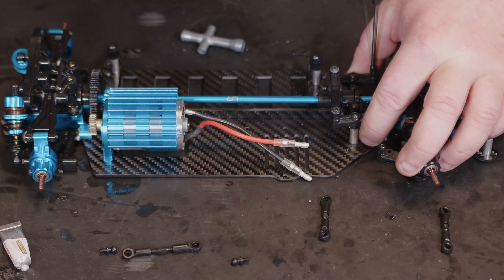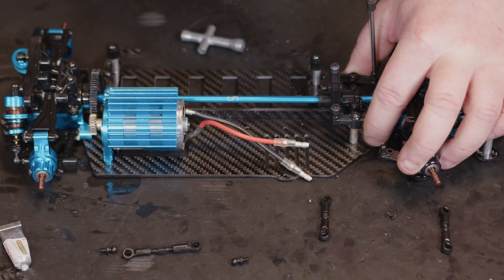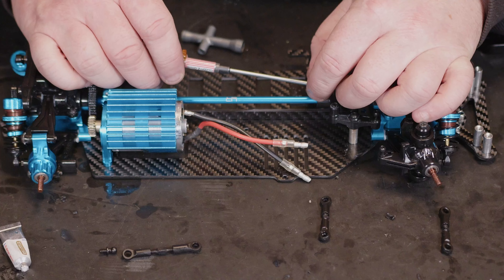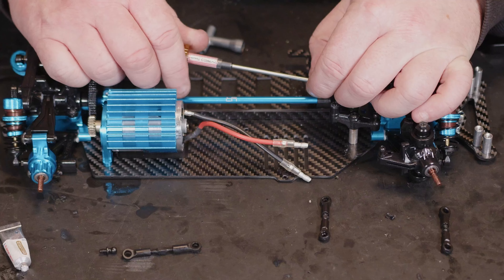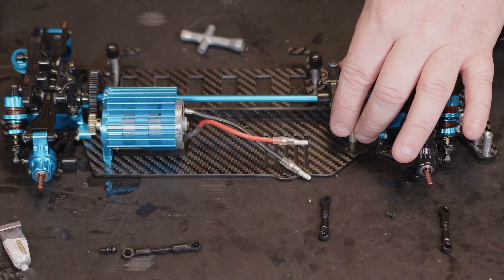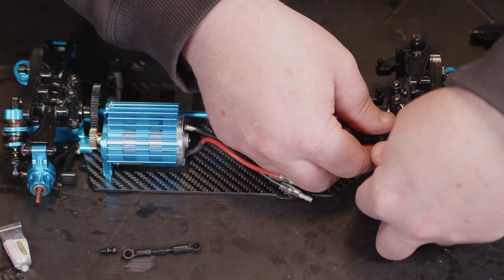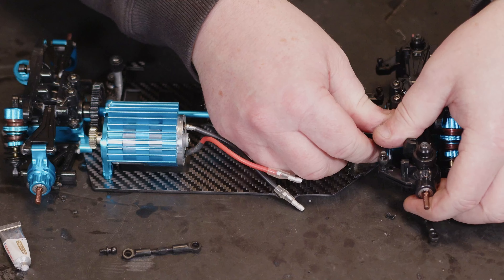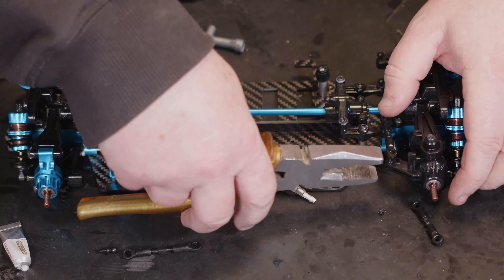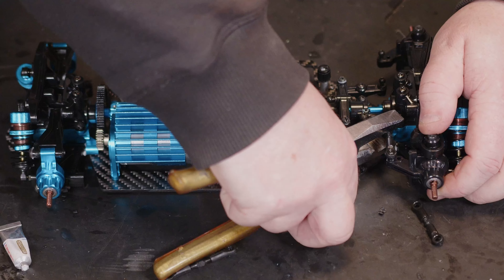You're basically just going to have to nip that down and then hope that the thread lock holds it, or else the steering is just going to seize up. Hopefully we can make that work. It's the first part of this that I've actually found and thought that's not very good — it's literally just that little metal shim that needed to be ever so slightly longer, or you could shave the top of the steering arm down. I'm wondering if it's designed to actually work with the aluminium ones.